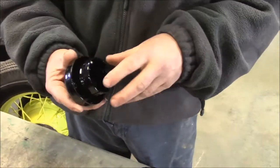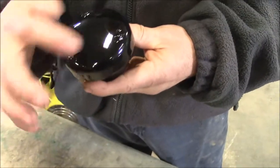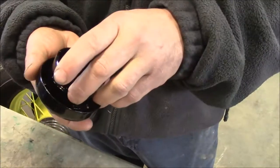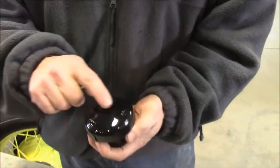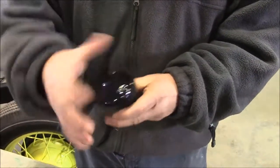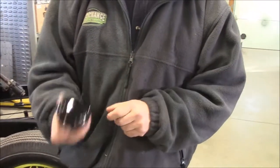And some of the metal back then, like you can see here, some people say this is kind of barbaric in terms of the way they built it. But that was the technology back then. They had this top cap they punched holes in, and there are 3 tabs for this bottom shoulder. So this is a 2-piece unit. This piece was slid in from the factory, bent over, and then they just tack welded those 3 locations. So what we did is we sandblasted it and prepped it correctly for powder coating. So now this is a powder coated finish.